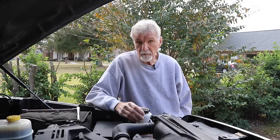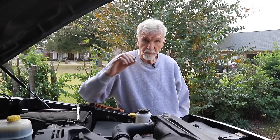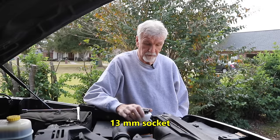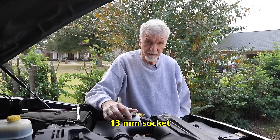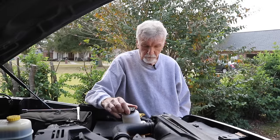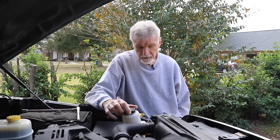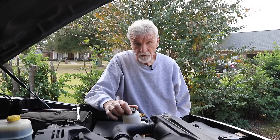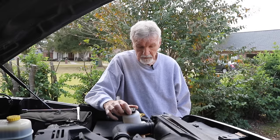What I'm going to do is remove this one bolt off of your hydraulic reservoir for your power steering, and then you can just pick it up and move it out of the way. I'm not going to disconnect it or do anything like that. There's a rubber hose — there's not plenty of room, but for my old skinny shaky hands I think I can get down in there and open that thing and close it. We'll see how that works out.